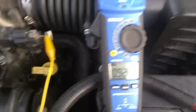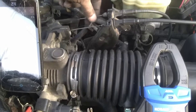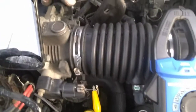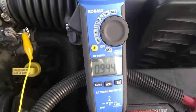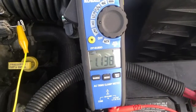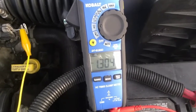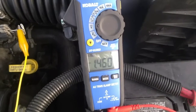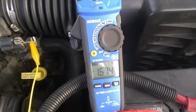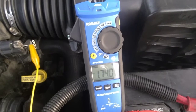Now this sensor — whenever you move the throttle cable, and if you've got a drive-by-wire you'll need an assistant to press the gas pedal — but since this has a throttle cable, I can move the throttle right here. You want to slowly rotate the throttle. Make sure your voltage doesn't drop out or fail to increase smoothly. Keep doing this until you're satisfied or you see a problem. Go real slow — you don't want to miss dropouts. It's actually better to check it with a scope, but a meter will work fine too.